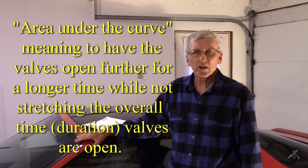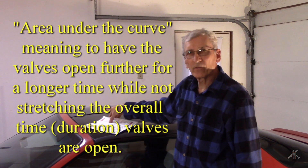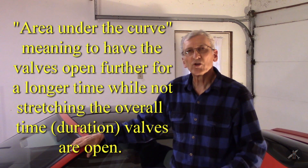But I didn't want to go wild. The factory cam in these early IROCs was one of the better cams, so I didn't want to go too far. But the cam technology has changed, and the goal was to get a little more area under the curve. I chose a Lunati for this build — one of their Voodoo cams — which lifts the valves a little faster and sets them down a little faster than the flat tappet cams of the 80s did.